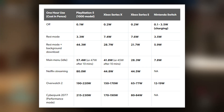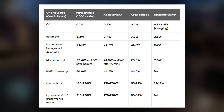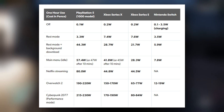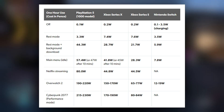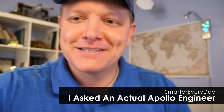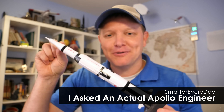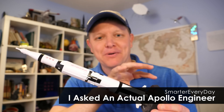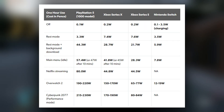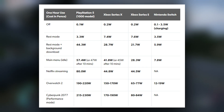Next is power consumption. A typical gaming PC can pull anywhere between 300 and 600 watts from the wall. But from a console perspective, the more power consumption required, the beefier power supply you'll need, the bigger cooler, and ultimately the larger chassis. This looks a lot like the rocket equation — the more power we need to blast off into space, the bigger engines, the more fuel, the larger system, and it's just this endless cycle. So ultimately, I'm shooting for a PC build that's anywhere between 100 and 200 watts of total power.